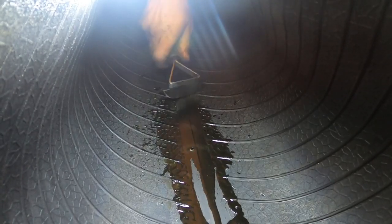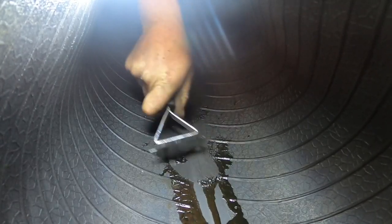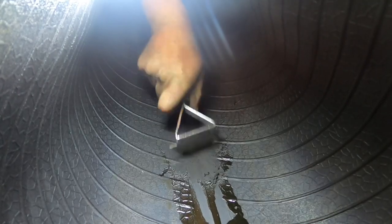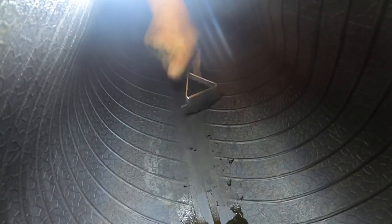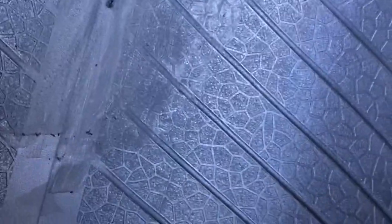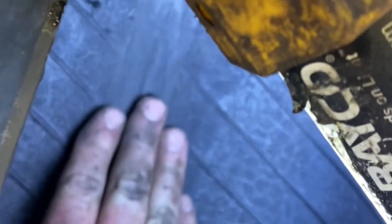I like to use a little bit of bead sealer to help cover up that patch after I get done — a lot of people don't use that but I do. So let's get started, first thing we're going to do is the pre-buff cleaner. After you've got it kind of cleaned up, now you want to buff it. You want to buff it to a little bit larger than the size of the patch you're going to use. When you buff it you'll get all the grooves out — you want a nice uniform, almost like a velvet-like feeling to it once you get it buffed out. Hook up the air and we're going to buff it.